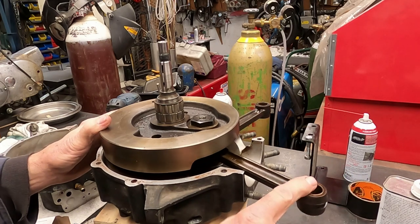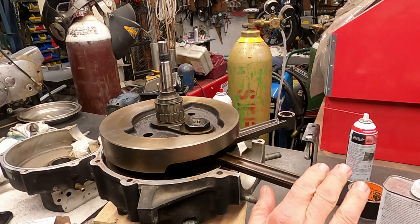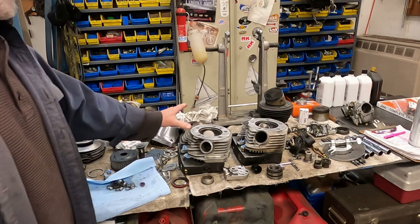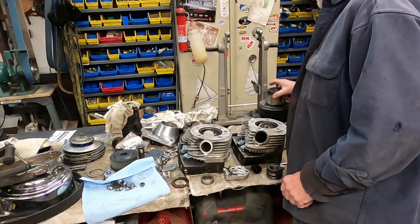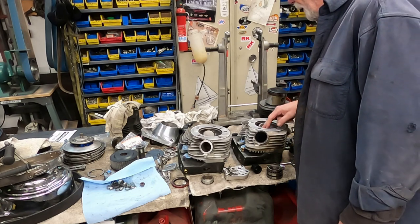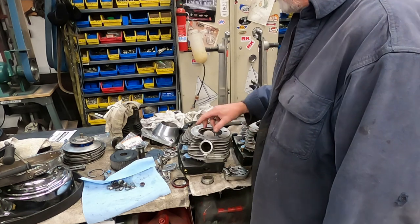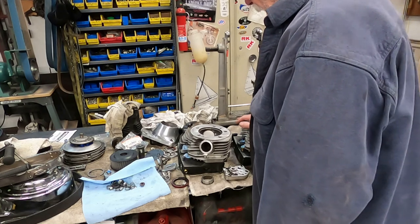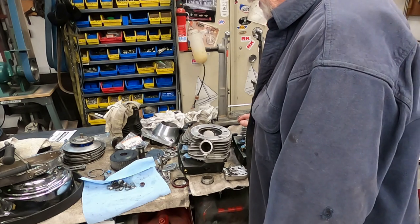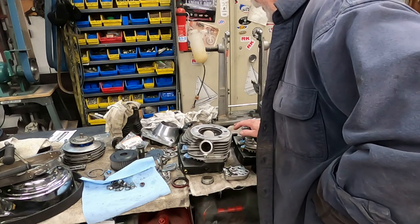My bearings will be in Monday and then I can finish putting this together. And then we can get to replacing the wrist pin bushings — these aren't bad, but I would prefer to replace them. I cleaned a lot of these parts and pieces, I've got the new pistons and cylinders in. And I'm going to do a leak test later on the valve area to see whether I need to pop them apart and fix them. Hopefully with the bearings coming back for the right side, I'll get that together, do the wrist pins, and then this can go the rest of the way back together.